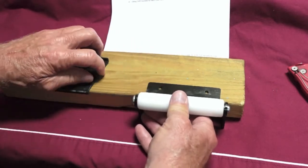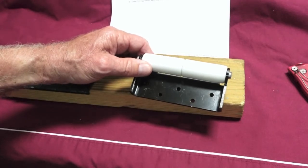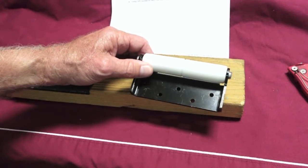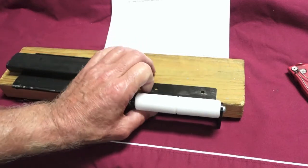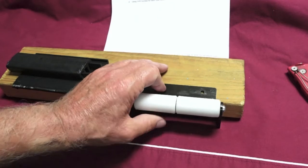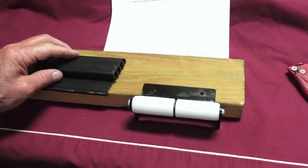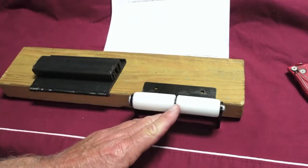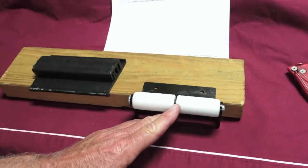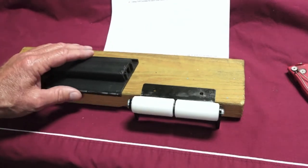And if the screw structure will support the weight of your slide out, you're not going to have any problem there. But again, figure out what you've got, who manufactured your slide out, what kind of wear bars you've got, do your research, and just try to make the best educated decision you can. But I'm going to follow BAL as close as I can on this one. I think anything I do is going to be better, and I'll have peace of mind knowing that the rollers are there to assist with the wear bars, even though I think they're going to be setting a little bit higher than what would be considered ideal. If they do wear down, then of course the OEM wear bar will be there to assist.